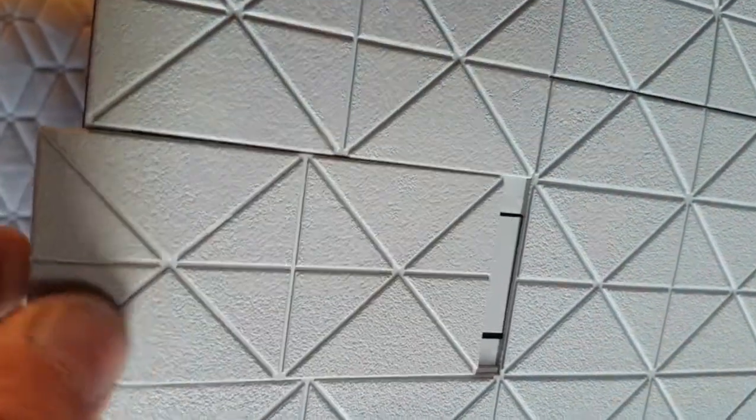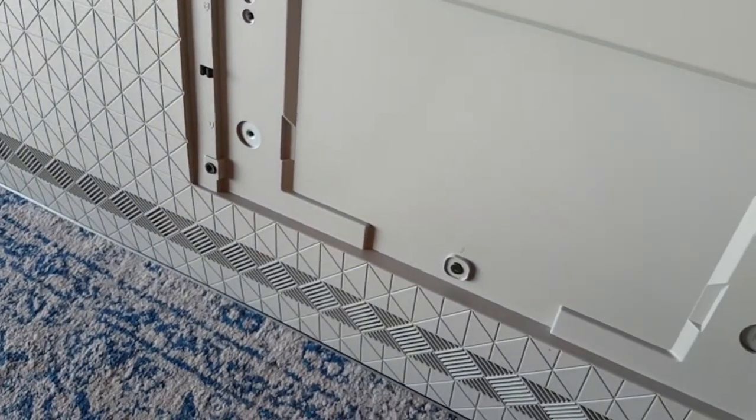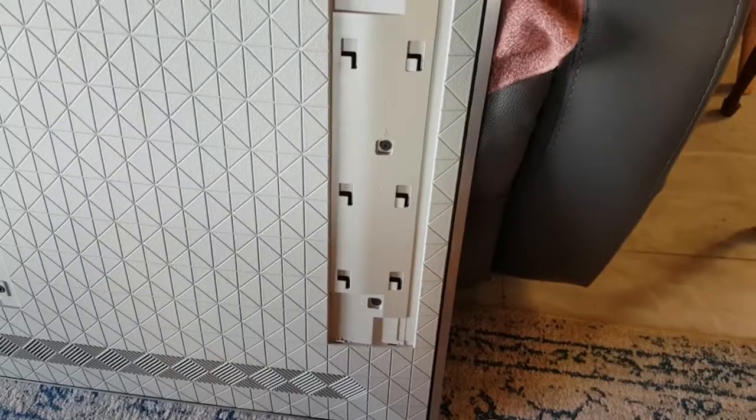It's really just a matter of getting the TV off the wall. I put it on the floor upside down because the cover pops off on the top side, and it seemed easier to work from underneath — so we leaned it upside down against the couch. It's probably better not to put too much weight on the front of the TV. You can lean it against the back of the couch, just being careful not to put too much pressure on any points on the LCD screen, as they break fairly easily.